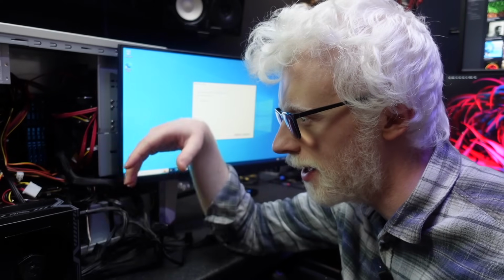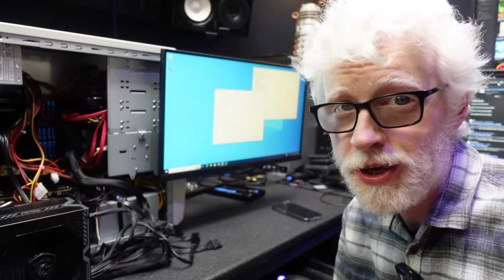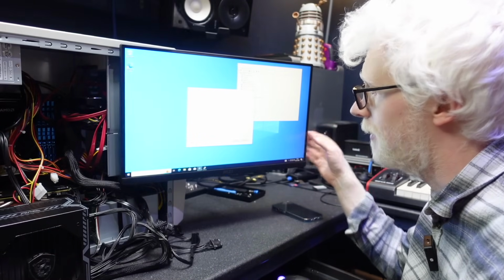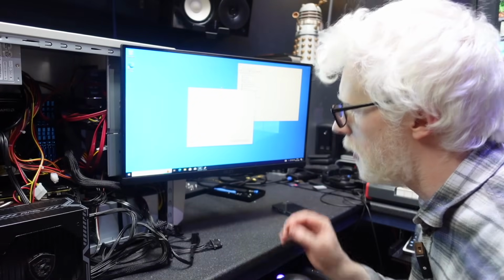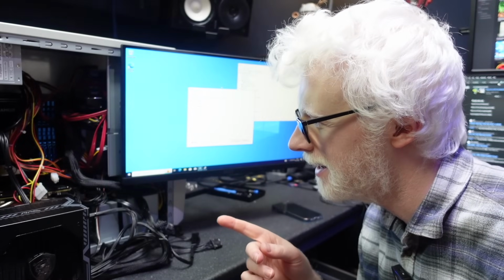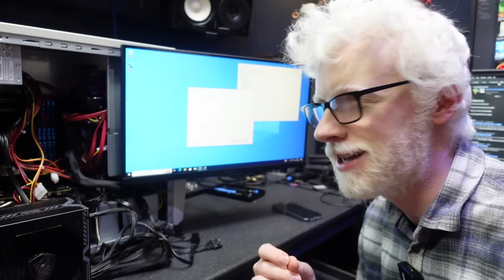Really, throughout this whole thing, I think we may have been dealing with a multitude of problems, but we may have solved one of our biggest by investing in another power supply. Huge, huge news. I cannot believe this. The machine has picked up drivers for the RX 580, for the first time since I built it. I was getting some almost close-ish results, getting a specific ASUS RX 580 driver running, bearing in mind this is not an ASUS card, or at least that's what it was detecting as under Windows.